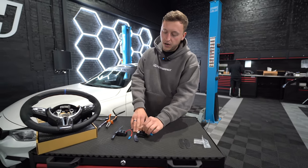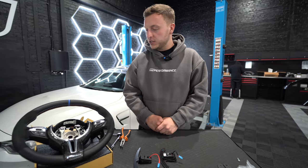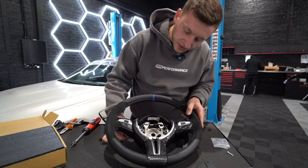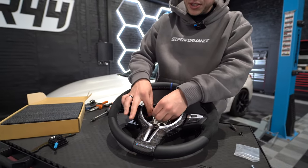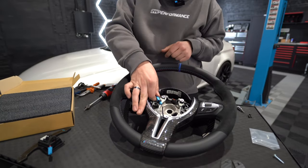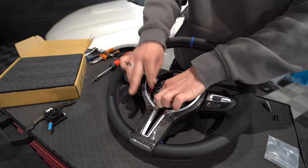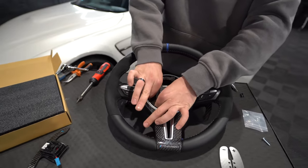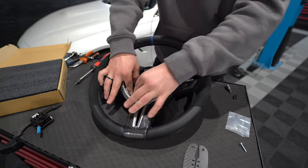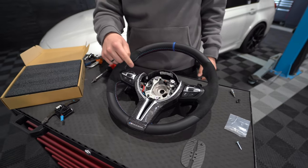It's a bit of a sound thing we're hearing now, but it's mainly that feel and passion when driving the car. Now for the reinstallation — it's a simple process of feeding the cable back through. Don't focus too much on the position of the paddle first; the main thing is to get it all plugged in. Push that in there, feed the cable back down. This side of the clip has a toggle that clips into the backing trim of the steering wheel, so push it down and in. Then put your cable back in.